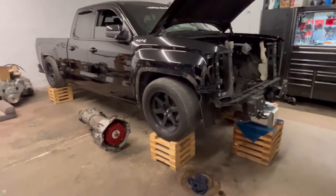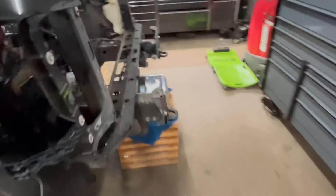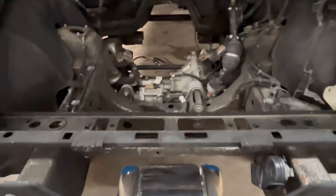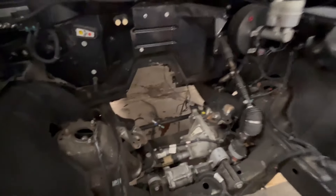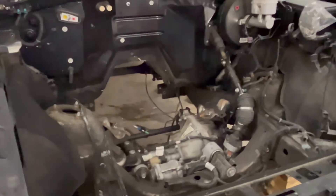Finally got the truck inside and up on the stands. I just pulled out the transmission and transfer case that's been hanging literally by the transmission mount for four years. Front end off, which was mostly off already. I'm going to have to wind up cutting this crossmember out and moving that all up for the intercooler. So next plan of attack: cut these motor mounts out, cut the factory transmission crossmember ears out, then probably remove all the brake lines, the wiring, and all the factory fuel lines because we won't be using those anymore. Then I'm going to start fitting the motor plates, getting my driveline angles set up, and hopefully putting this basically right back in. I'm going to start laying out the driveline angles in CAD and getting my motor plate brackets drawn and the motor plates trimmed up.